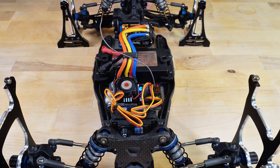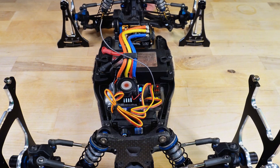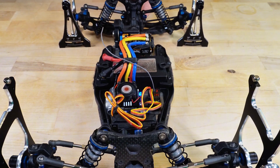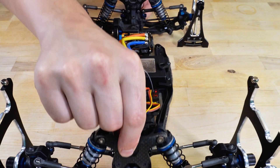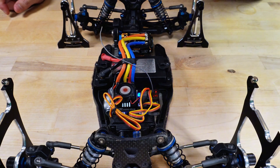Here I got a little confused as I noticed that the camber changes if I push the car up or down. Apparently, this is called camber gain. This happens because the back arms are suspended by shocks and can move. So depending on whether I lift or push, the shocks settle at different heights, which is why the angle changes. I've been told that the correct way is to push down and let it settle, so that's what I did.